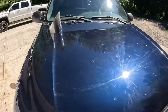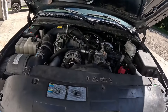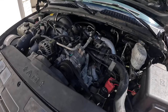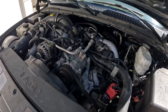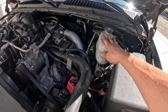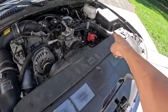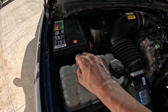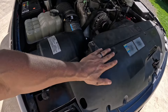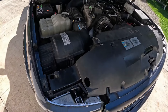Got a nice little hood stack going on. Pretty much just a stock LBZ in here — 140,000 miles. A few things I had to do: hydraboost from a Duramax, Duramax fuse box, two batteries — one over here, one over here. Hood dump exhaust of course. Core support is all 2500 — it's got the 2500 radiator, intercooler, and core support.